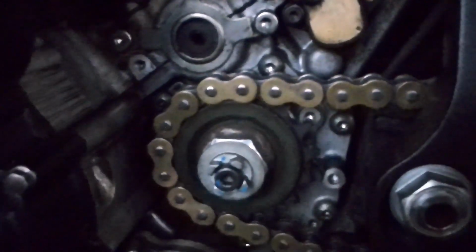In order to fully take this cover out, you have to spin this bolt, which is tied to the clutch cable, to take out this part. Then you hook it off, and here you go. And then we have to wash this. It's pretty gummy inside. Okay, so we clean out this area. You can see it's cleaner now.